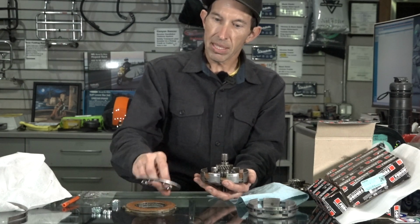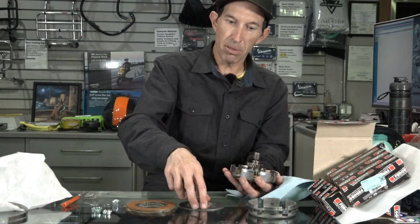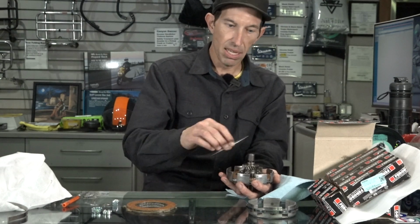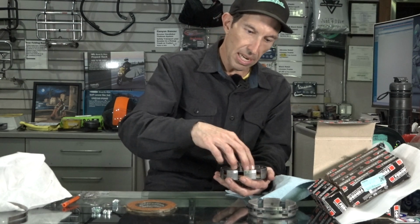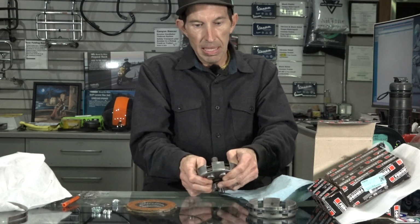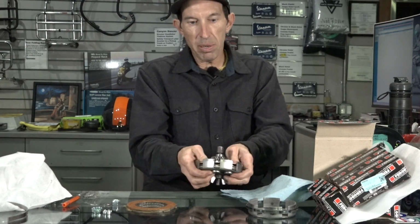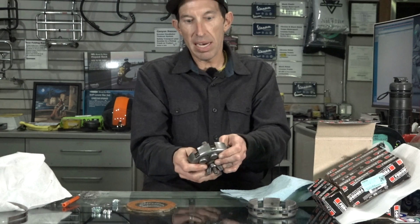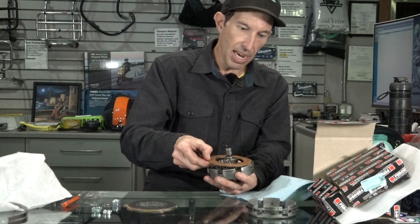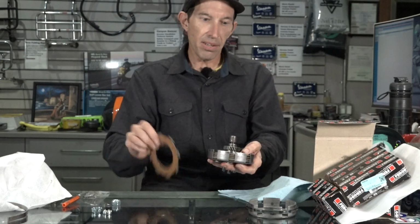And a steel plate. Sometimes you may want to file these edges because they are a little bit hard. If you're going to reuse them, you put them on a glass table, make sure they don't rock, because when they're warped, they'll usually take up a shape like a cone a little bit, so they'll rock. Doesn't matter what position, but kind of line those up with those teeth. And this one's taking a little bit to get it to drop down onto that hub, and it may be worth filing it. My experience is after some use, they'll just free up anyways. And when it's a nice, worn-out clutch, all this stuff falls apart really easy, is my experience. This brand new clutch, everything's a little on the tight side, and you have the last one, kind of just line it up.